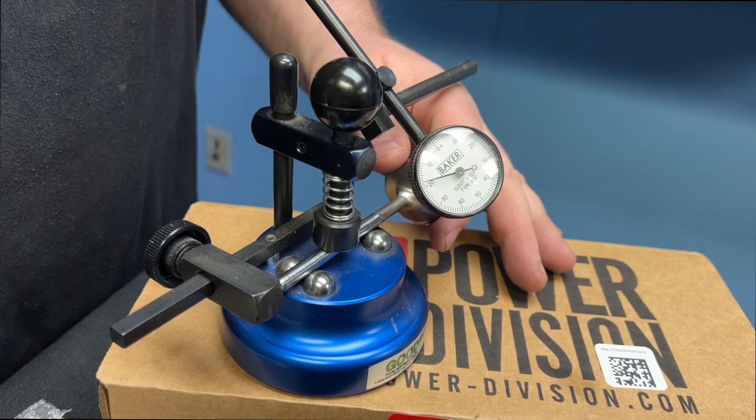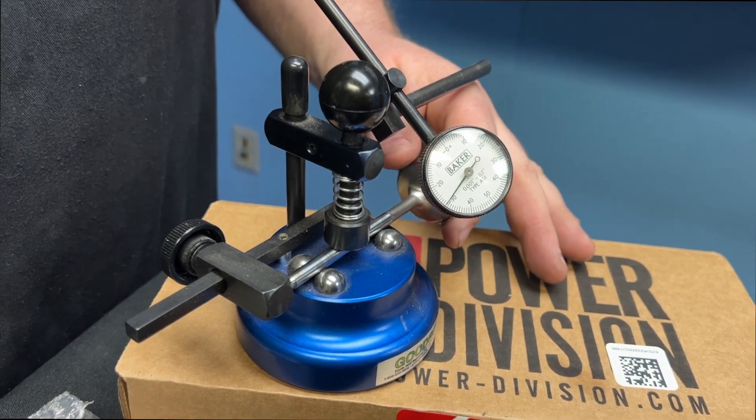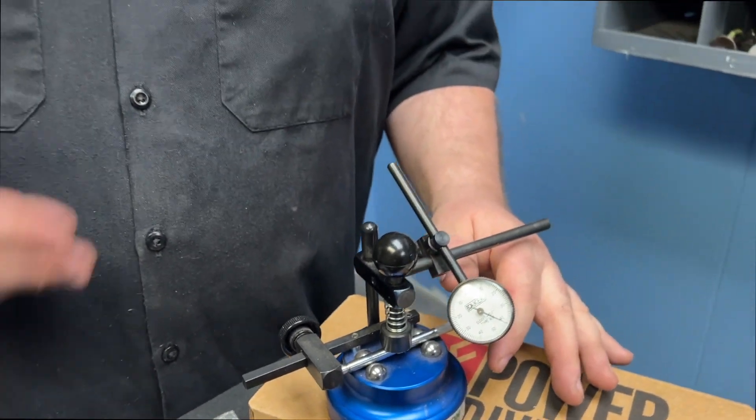This was actually the noise he was listening to. Bent valves will make a ticking noise and you might think it's the bucket or something else going on. You're checking lash, but lash is actually a good thing to look for because it's going to open up if the valve is bent enough. For some weird reason, the lash kind of stayed on point with this — maybe Tom's a lucky guy — but that's what happened, and we found the noise.